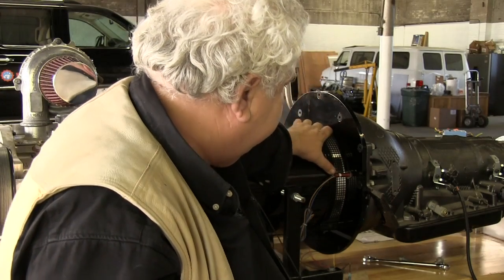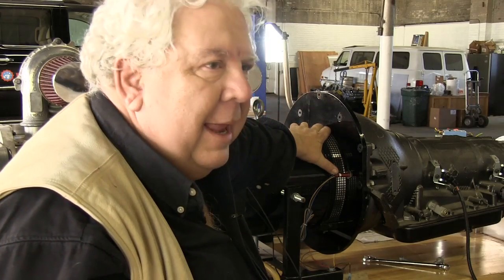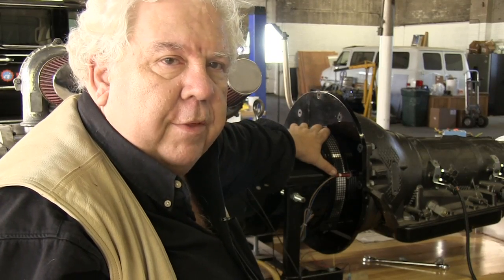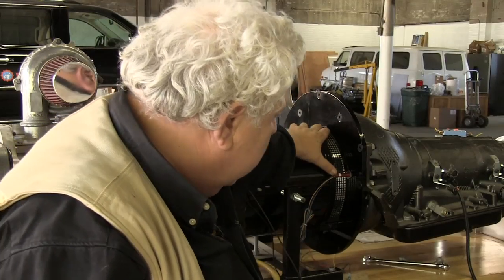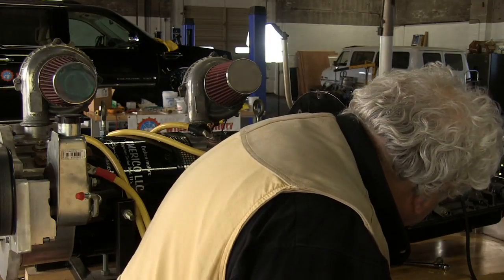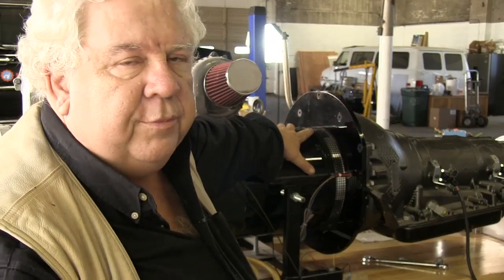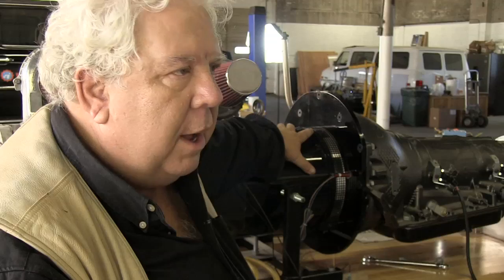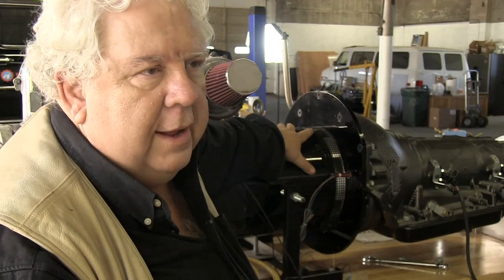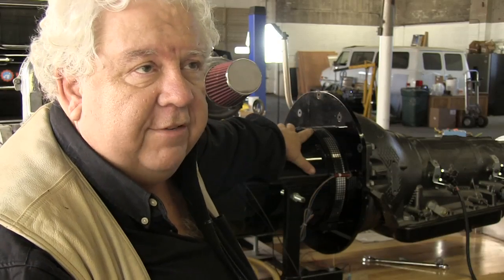This is a Cherry Systems NPN open collector magnetic pickup. It'll pick up the passage of the south pole of a magnet. On our flex plate, on the connecting bolts, we have attached with just some epoxy, some little ring magnets. They're just common ring magnets you can buy on eBay. It doesn't matter what size or anything. What does matter is the polarity. You want the south pole facing out.